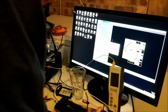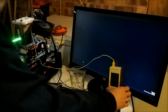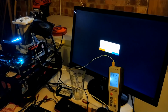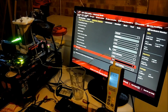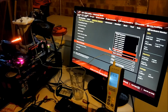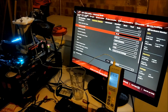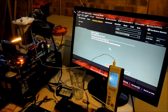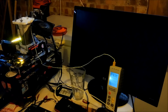And there we go. Cinebench error. That's a shame. Was not to be. Right, we'll definitely move on to 11.5 now, and we'll do some other benchmarks. Straight in now. So we'll lower that memory frequency back down, and performance bias will change to 11.5, keeping it at 49 for now, and we'll boot into Windows and try and run Cinebench 11.5.